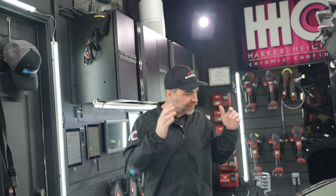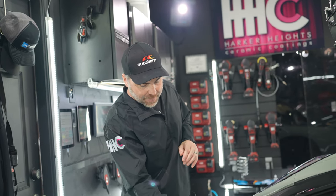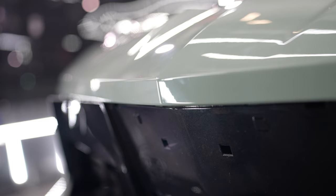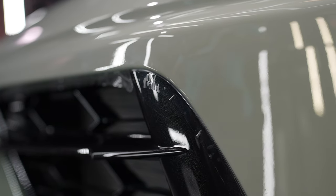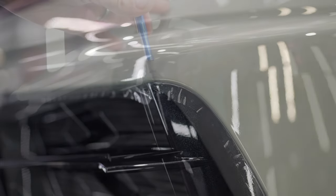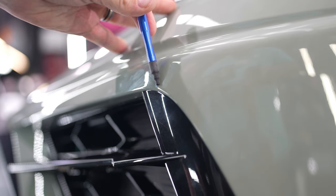Now I'm going to show you how we tidy up the PPF at the end — this is what sets us apart. We're very detail-oriented and I try to make everything as invisible as possible. On the C8 Corvette, I manually extend our patterns. Many patterns have a notch in this front bumper because of the sharp line, but I make sure it's tucked under so there's no exposed edge. As we get to this area, I wait until the last minute to trim the PPF. This is probably the most difficult corner on this bumper — I extend it for full coverage and tuck it in, then I'll trim it away and show you what it looks like.